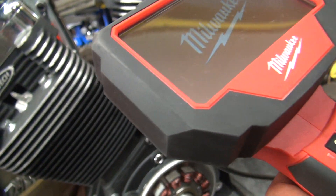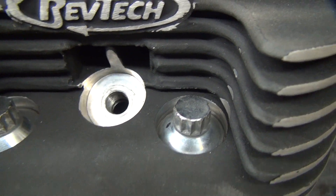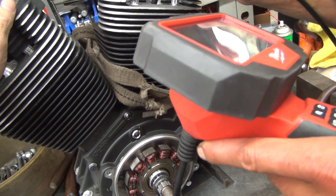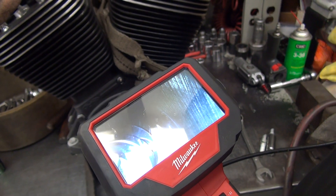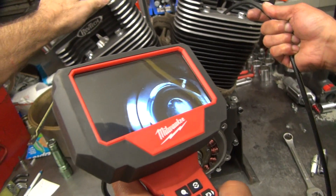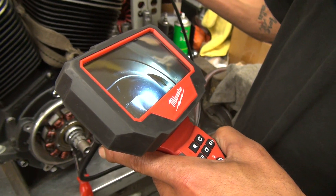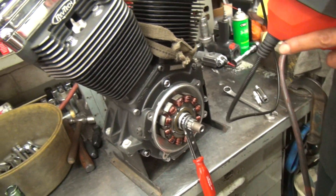The exhaust valve looks brand new. It's got a high lift valve - look at that thing, it comes up fast. Battery died - it says the battery's fully charged. There we go - it looks pretty fresh in there. You can see the vertical stripes from normal abuse, and there's some cross hatch in there unlike that last job. It's definitely all new in there. You can see the valve pocket - that's a dish piston.